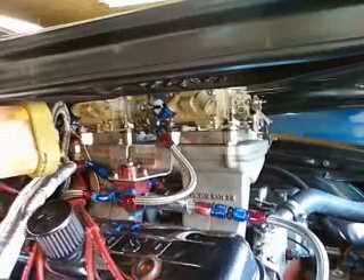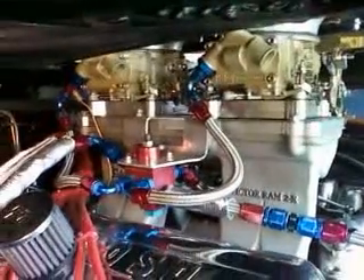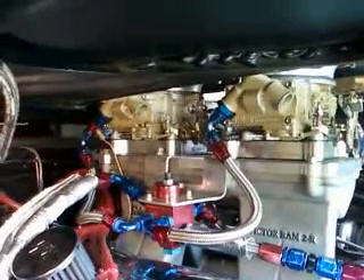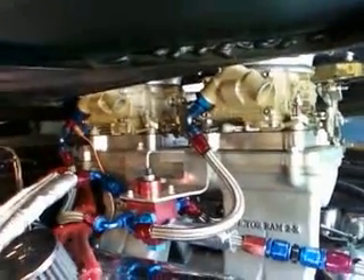The pickup is at the bottom and the vent is at the top driver's side corner towards the axle — actually on the side of the tank. This worked great. My fuel pressure stayed between 6.5 and 7 through the whole run. The gauge shows between 6.5 to 8 — it moves around a little, bounces up and down, but nothing major. Nice and steady at higher RPM. I had no vapor lock issues, no hard starting issues — nothing. Everything was solved with the return line.